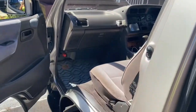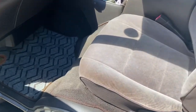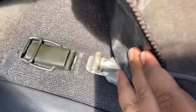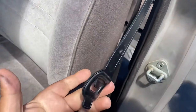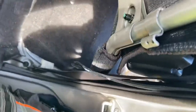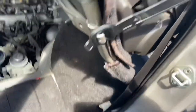On the passenger side, you access the radiator reservoir and fill cap underneath the passenger seat. Go ahead and lift the carpet, flip the latch up and unhook it. Then, in order to hold the seat up, there's a little latch holder on the B-pillar. The seat gets folded up — and boom, latches in and holds the seat up.